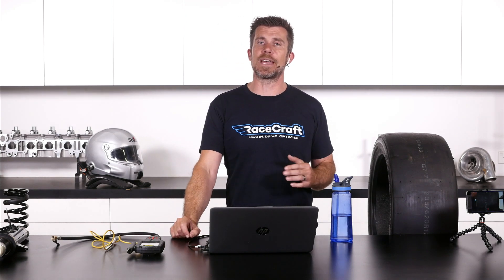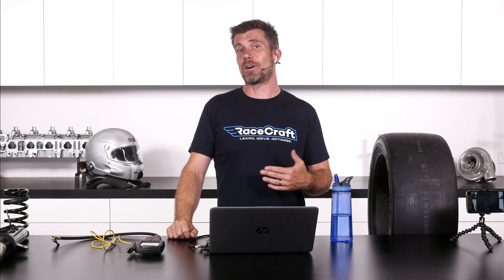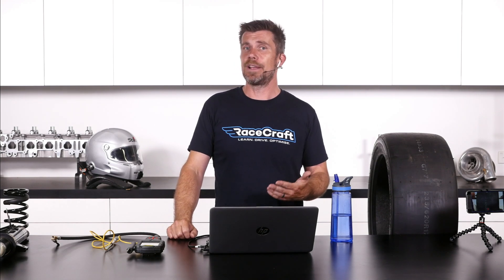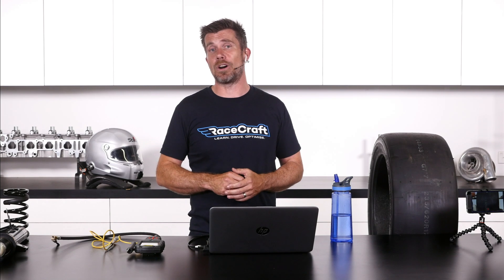The problem with that is that once we've jacked the car up, made our adjustment, and dropped it back onto the ground, we're going to find that the car won't immediately settle back to natural ride height. You can actually prove this by measuring your ride height after you've driven your car, then jack the car up, drop it back off the jack, don't move it, and then measure your ride height again — you'll find it measures quite significantly higher.